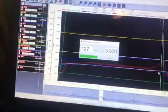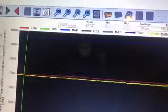And our fuel pressure right here is 67. So 61. So 4 pounds, 2, 4, 6, 8 psi. It's at 61 and it leaves at 67. So 6 pounds. So that's pretty close. It's about 2 psi off. We're at 2 psi off, which, like I said, we're on a limiter.